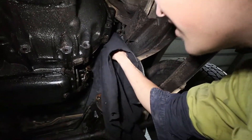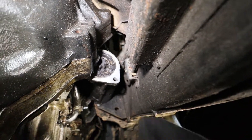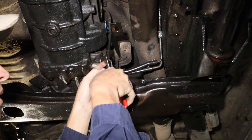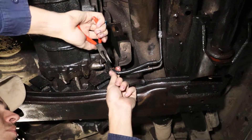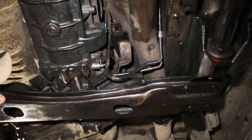There's a bit of crud in there, so the rear main seal is probably also gone. Grab the hose clip, open it up, pull it down, then grab the hose at the top and give it a wiggle as you pull down — that should stop you tearing it.